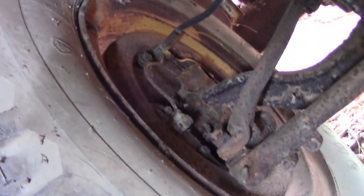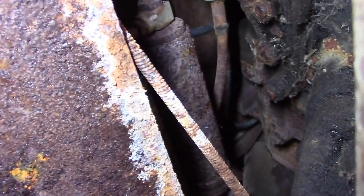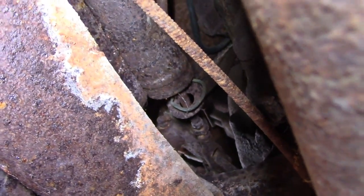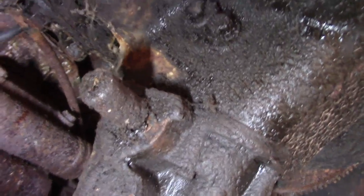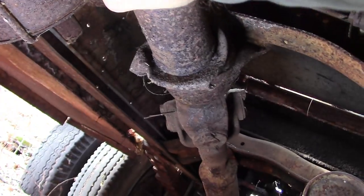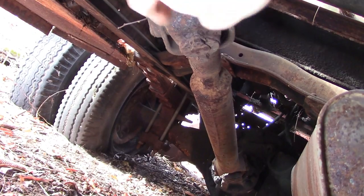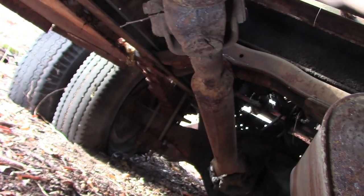I can't do my same trick with the jack over here on the other side because the exhaust pipe's in the way - I don't have enough room to weasel the pry bar in there. Lots of other problems too: looks like we've got hydraulic wedge brakes on the front. Those will probably never work again - they didn't work when they were new. The seals are all hanging out the front of the master cylinder, so of course we wouldn't have any kind of brakes. It does have some kind of PTO on the transmission. That big thing is a vacuum brake booster mounted on the frame rail. I think she might need a carrier bearing, and the drive shaft's either twisted or bent - there's definitely a dog leg shape right about there.